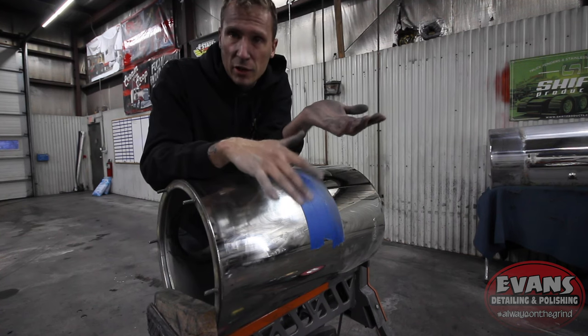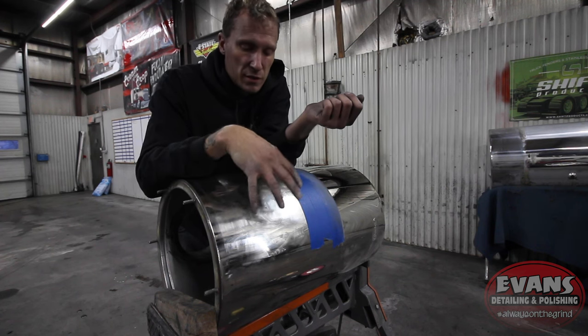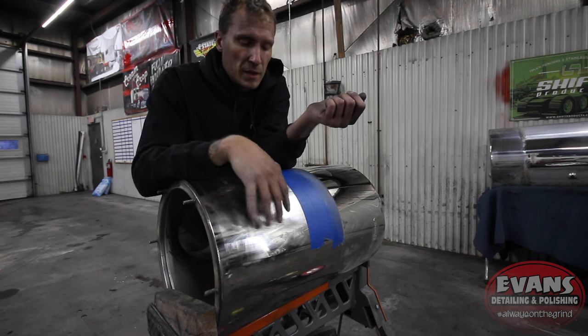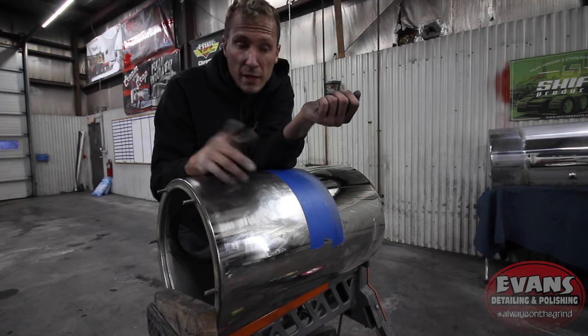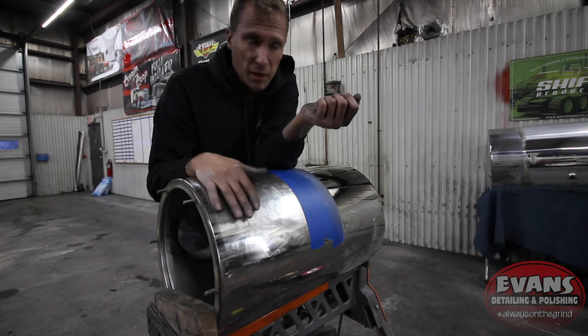I'm gonna try to do this kind of quick so that it's not a crazy long video for you. All we're simply gonna use is a stiff buff with a stainless compound, and then we're gonna jump into a softer buff with a softer stainless compound. Little greasier, easier to wipe off, and I'll show you how to do that. Stay with me real quick, try to pay attention, and I'll try to make this video as quick and painless as possible.